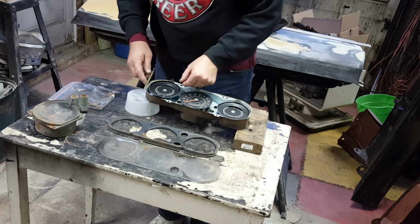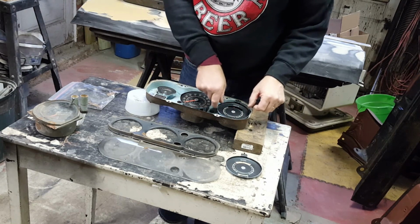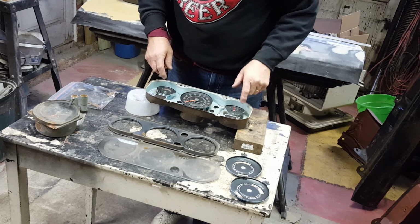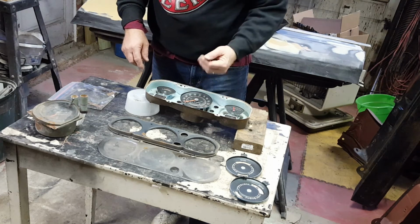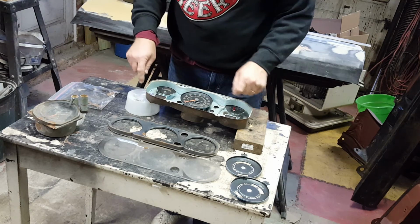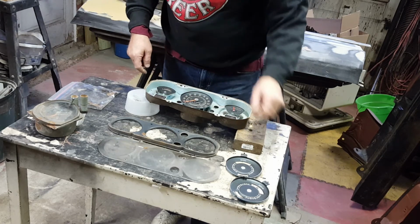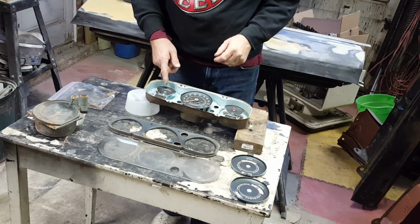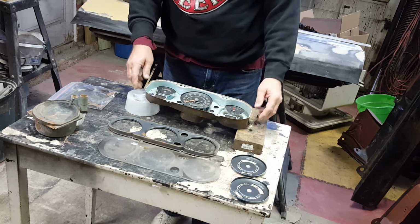So once the housing plate is out of the way, these plates here, which are in very nice condition, just come right off. And I'm left with, as you can see here, the fuel gauge housing, which undoes from the back with a couple of screws, speedometer assembly, a couple of screws on the back, a couple of lenses here that went behind the oil pressure and the temperature idiot lights, and then this light up here, which says battery. So just like on other cars, if the generator, in this case the alternator, is not putting out the appropriate voltage, then that light illuminates.